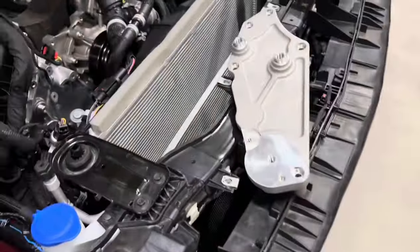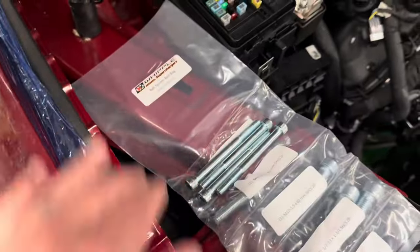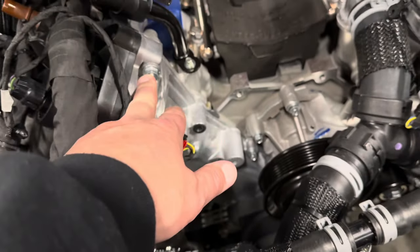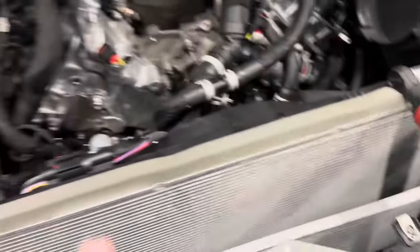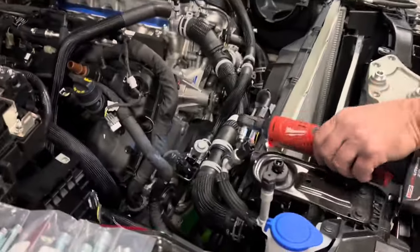We're getting ready to do the bracket system on the front — the pulleys. You've got your belt system bolt bag here from Whipple, and a lot of these are labeled really nicely. What we've just done: down here is where the ground strap goes, and Brian just took this out. You relocate it up here. You're relocating the ground strap up out of the way so you've got your belt for your whole bracket assembly with the supercharger. Now we're taking off the water pump pulley off the front.